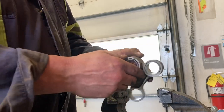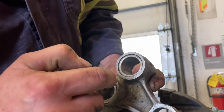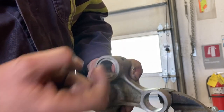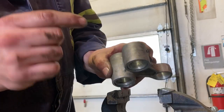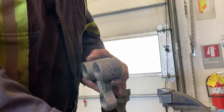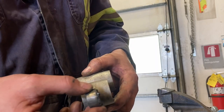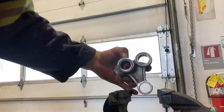So next I'm going to get a grease nipple in my top one here. If you look closely in there, you can even see where the bearing is and how there's just a little bit of a channel right in the middle. It'll be right on this line here where the grease will allow it through past the two bearings. Two are wider than the other two, so there's probably an eighth of an inch when you get to the seal surface — maybe less — but it will find its way into the bearing.